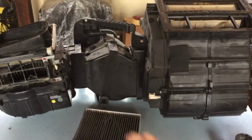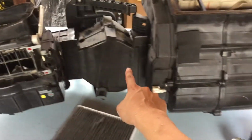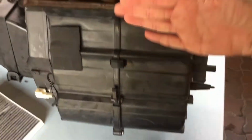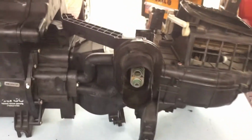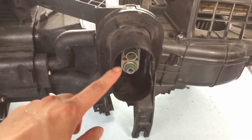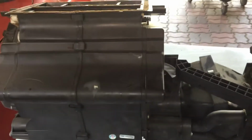The fan blower takes the interior air and pushes it through the cabin filter. Clean air then enters the cooling coil where it is cooled down and flows out through the aircon vents. On the other side, this is where the expansion valve sits that makes high pressure refrigerant gas expand, creating cold gas that flows into the cooling coil, cooling down air blown through it.